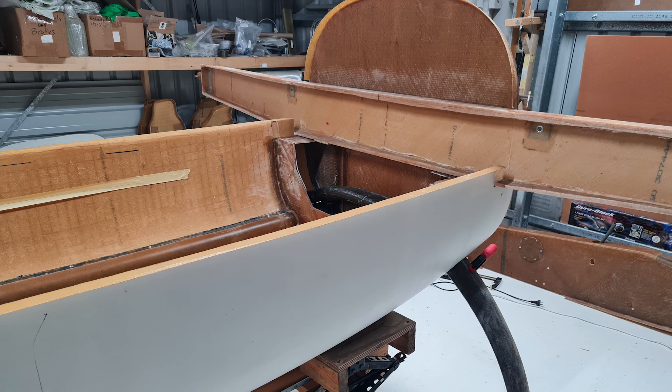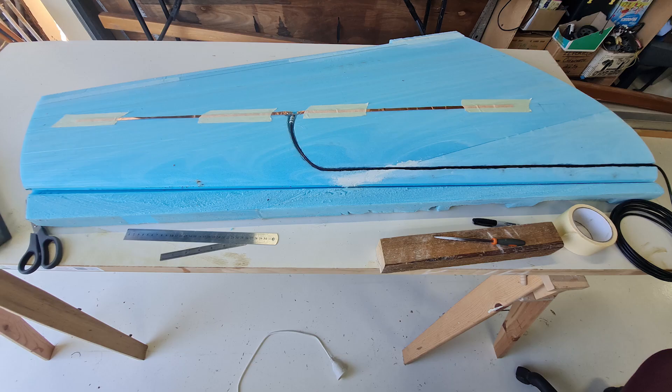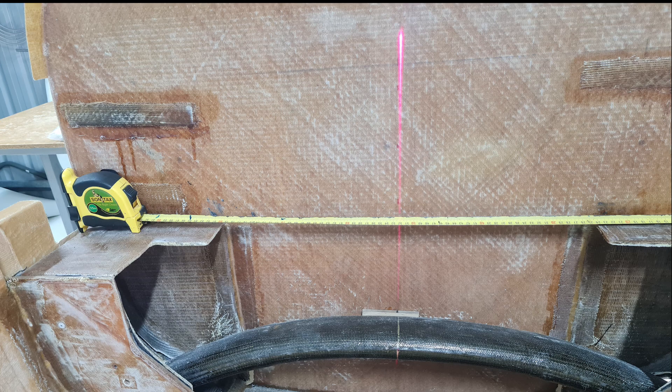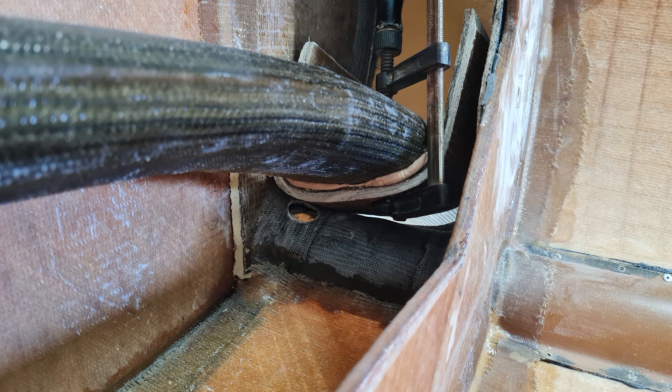As you can see, we're installing the main gear, the centre or the main spar and we started the winglets. We'll start this video with the main gear. The first step was to ensure the gear legs were centred. Here you can see I've used my right angled laser to align the centre of the gear leg with the centre of the fuselage. The next step was to bond the gear saddles to the gear leg.